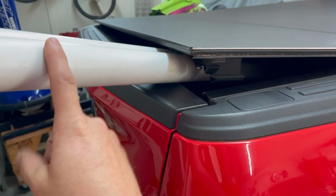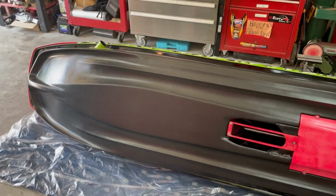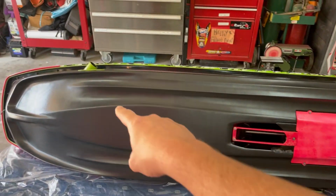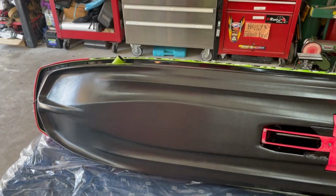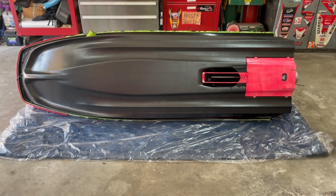And I've got some things that I'm going to try to do with my bunks. Cut these in half and try to put them on top of the bunks. I think that'll be a lot smoother. And then obviously put carpet over the PVC. And I think that'll protect from scratching under here like it has been doing with the 2x4s with carpet on it. So, yep, let's get to it.